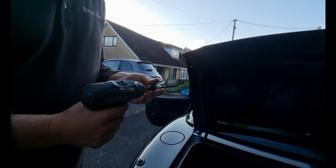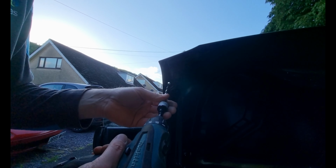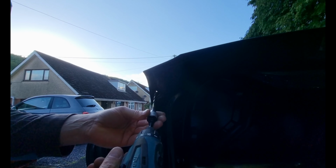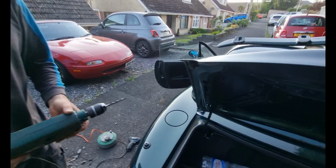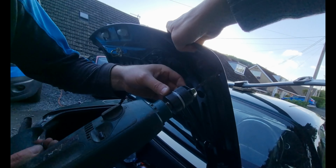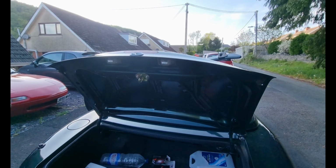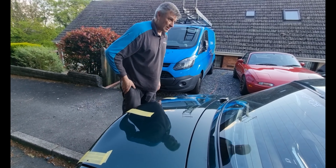Third drill size. So just going up the drill bits one bit at a time. I think I'm expecting too much of my little chuck. Alrighty, we're going to a bigger drill. Just like that. See on the other side, just to pull it out. And try again. We just go up one drill bit size at a time so we don't get too excited.